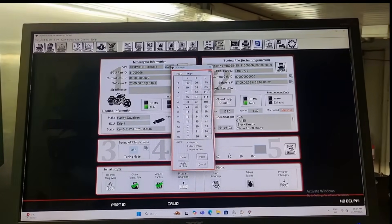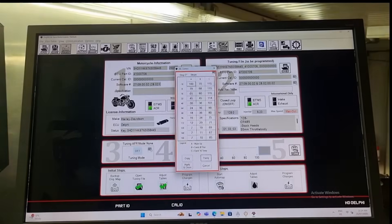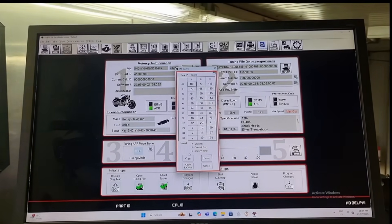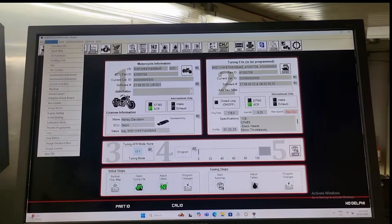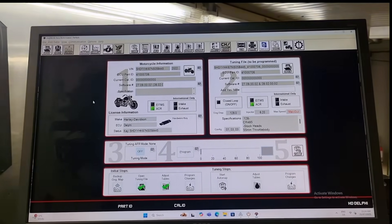The ACRs are turned on. The engine idle temperature management system is turned off — that's the one that shuts off the rear cylinder when it gets hot, just to save fuel and heat. Just a quick overview here — it's pretty standard, doesn't look like anything's changed there to be honest. The IAC — that's how much idle air control is going on. But guys, that's what we're going to do: we're going to baseline this thing now and see what it makes.